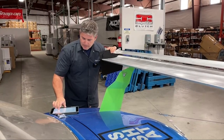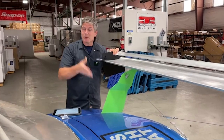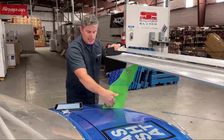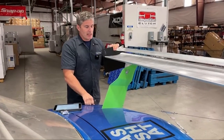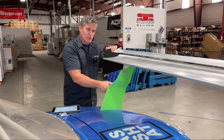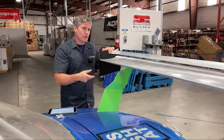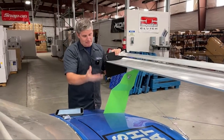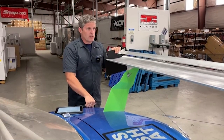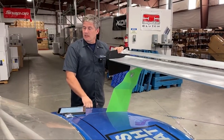There are a lot of questions about subtle aerodynamic modifications. That's where we get into things like the GV lip I talked about earlier. This air dam is not subtle but easily removed — just attached with a few bolts. The little trunk lip, the small lip spoilers, don't really do much. I asked Tom Matano about the R package trunk spoiler a few years ago, and he called it 'aerodramatics' — they don't really do much at all. The front can do quite a bit; the back looks cool. On the street, the best aerodynamic improvement you can make is a hardtop, because it's considerably slipperier than the soft top, and quieter too.